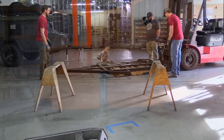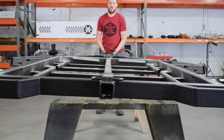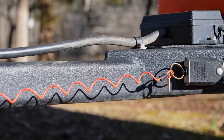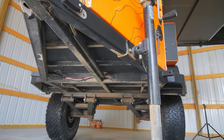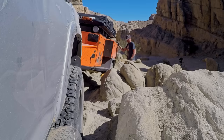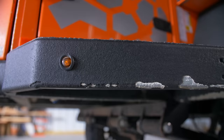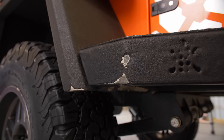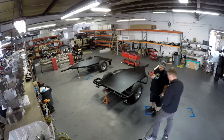Let's dive right in with the most important component for any off-road trailer worth its salt: the foundation of the build. This trailer chassis is built with CNC-cut 2x3-inch tube steel, which is jig-welded to ensure the highest accuracy possible. The tongue is made of heavy wall steel and passes through the entire length of the chassis, featuring a 2-inch receiver both in the front and the rear for maximum rigidity and strength. You can see where we put the galvanizing to the test back in 2018 on some large boulders the very day after this trailer was completed. To date, there hasn't been one speck of rust that has passed through.